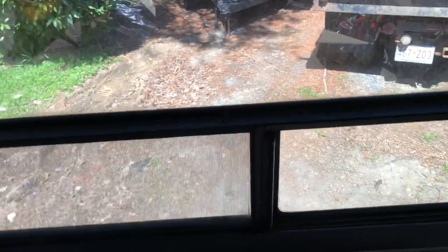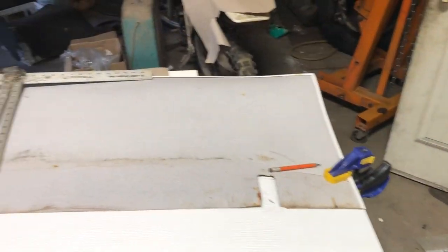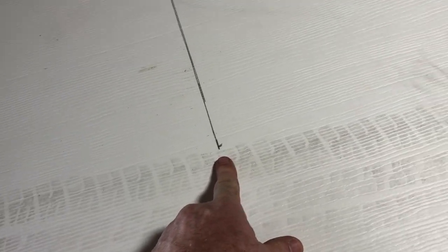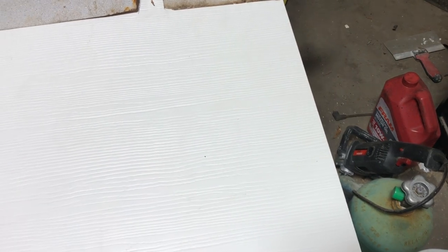We get to use this as a template. We're going to measure to the bottom of this, use this template on the top — that's going to be the right side edge — and then we're going to make a new piece. I've laid my old panel up there and marked out my cutouts for the seat belts and the outlet. I also need to come down to 35 inches to hit the floor. On this side I'm 24 inches, then nine out here for the step, and then down to my 35.